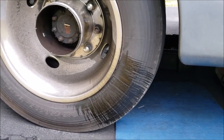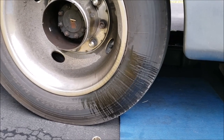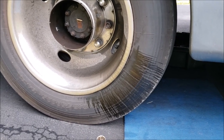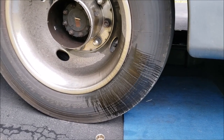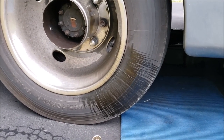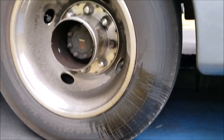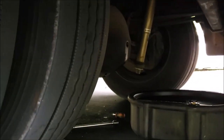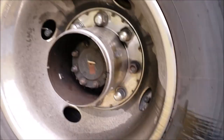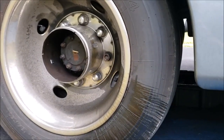This is different from ours. I've got the W24 that has the Dana S130 differential. This is a Workhorse chassis W22 which has the Dana S150 — which is kind of strange because the S150 is much larger than the S130 but supports a little less weight. It's just the way it's designed. So I'm going to crawl under here and drain this oil out, then see about pulling this axle out and see what kind of project we get into.